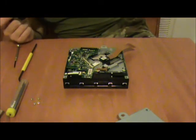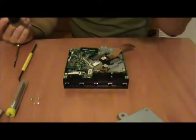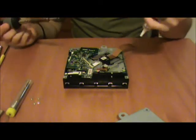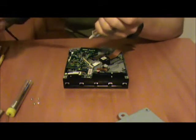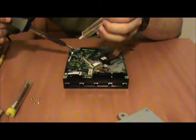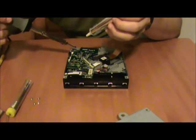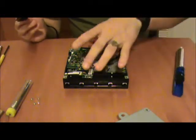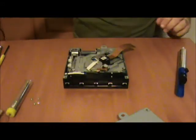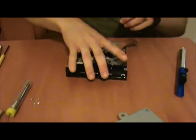Okay, so I'm going to get my desoldering plunger here. That's this guy. Uses air and suction to remove the solder once it has been placed into a liquid state. So here we go. To desolder, it just popped right off. Brilliant. There that is. Released easy as you please. That is a best case scenario. That is fantastic and wonderful. Thank you and good night. Just kidding, stick around. We're not done yet.